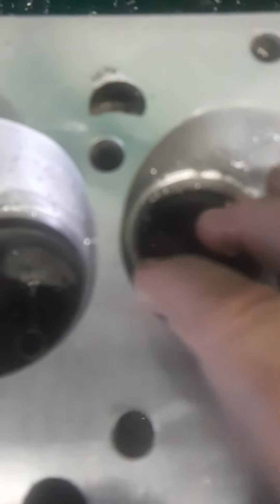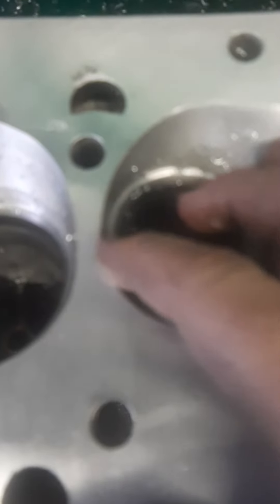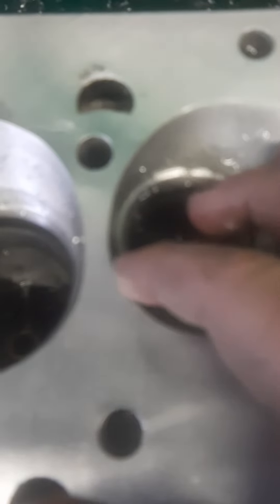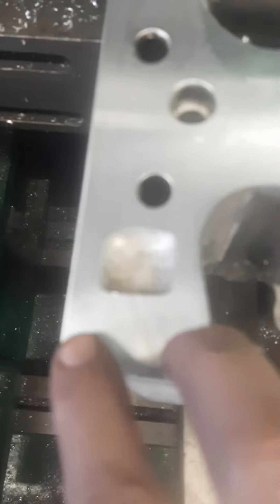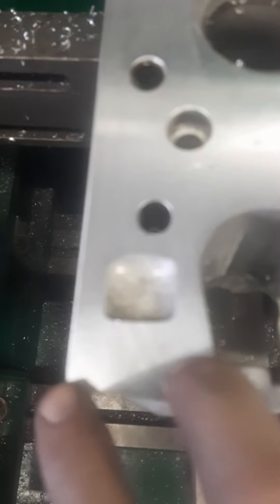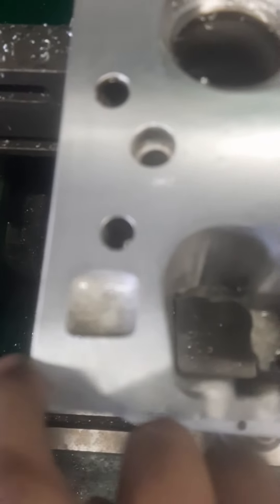I was talking about this having a little bit of a low spot. When I was milling it, I noticed you can bring the aluminum up. What I did on this one is I just took a ball peen hammer and tapped it up — I raised up the aluminum. It's really common on aluminum heads that people drop them on the corners, like right here, and a lot of guys will just mill them or weld them.